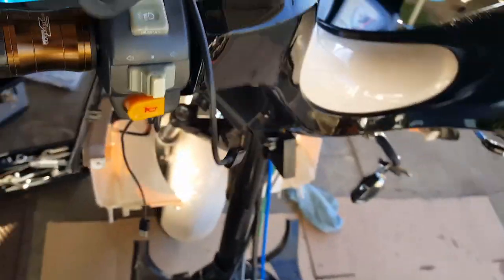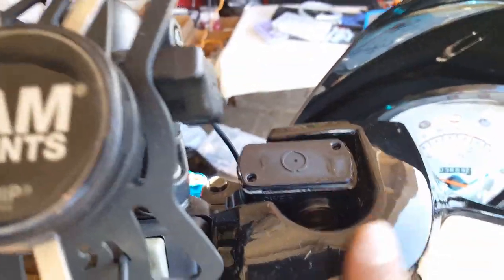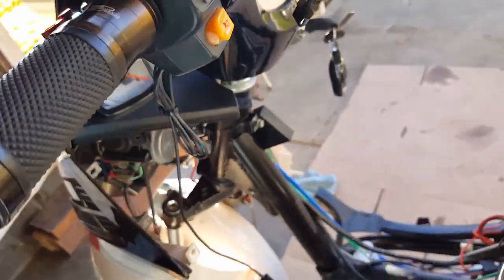As soon as we get this brake bled, there's going to be another cap that's going to come off. And before you start ripping out the cap, this is where all the brake fluid is going to drip out. Brake fluid is really harsh on your plastic, especially if you have it nicely coated. Luckily, I have most of the front dash removed, but if it gets on this right here, you can see some of the brake fluid stain.